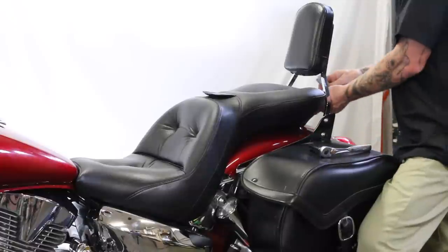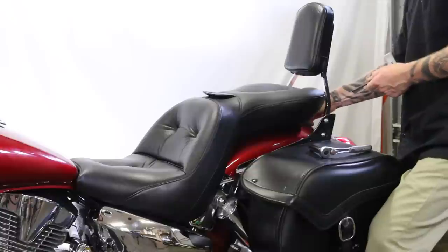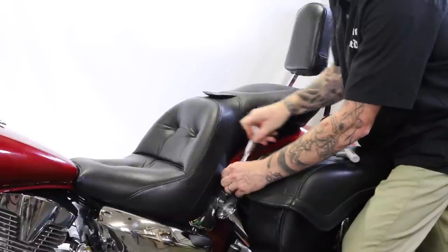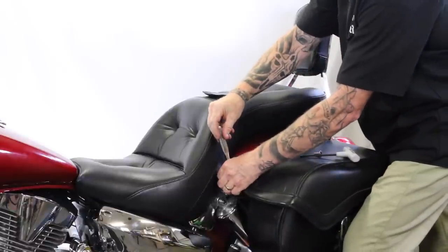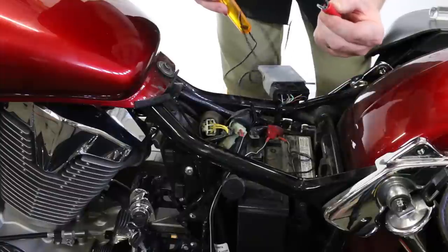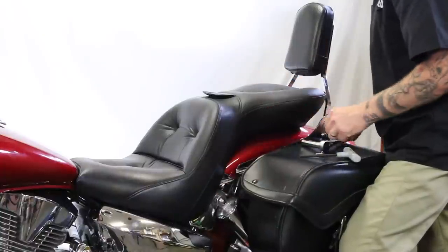Now, to get ourselves into some hot and negative terminals here, we're going to remove the seat. He's got a five-millimeter Allen on the back to take the bolt out, then a 12-millimeter ratchet — there's a bolt on each side he's got to take out to get access to the battery and take the seat off. Our plan is to hook the positive and negative directly to the battery, and then we need to find a remote power — a switch power, something that turns on and off. That's what cues the stereo to turn on and off with the bike.